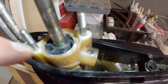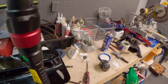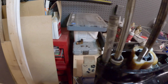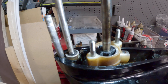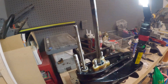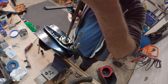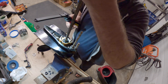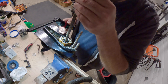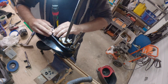The impeller needs to move, and these blades actually need to align so they're facing the right way. Typically the motor spins clockwise, so we've got to fix some of these blades here, make sure they're spinning the right way. We just take the screwdriver — I need two hands for this so you guys can see.